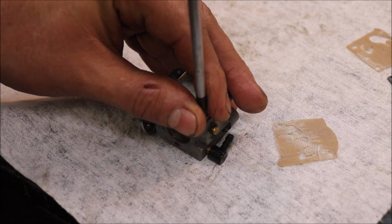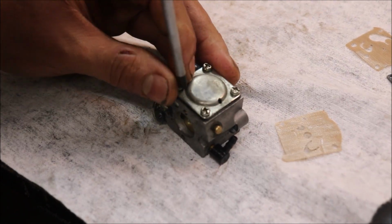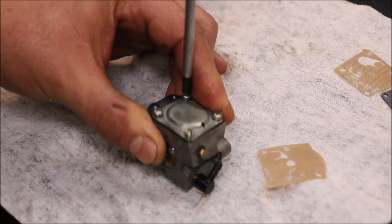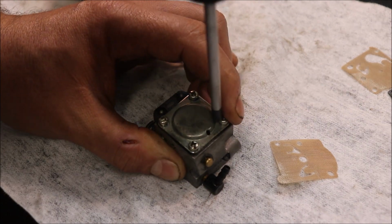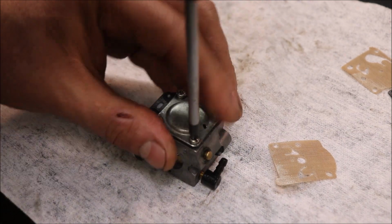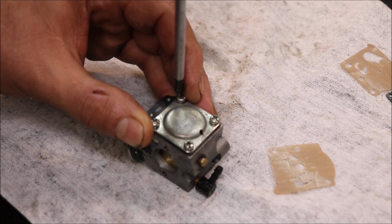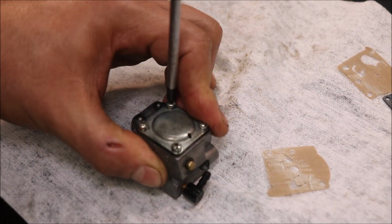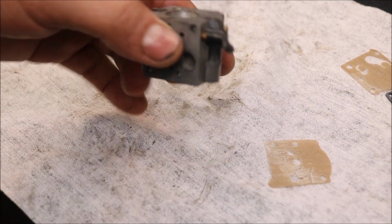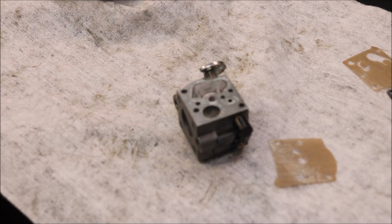I actually have another one of these saws. It's a 2000, I think. That is like in pristine condition. Simple Man had gave us. I had it out running it and then it just quit, so I'm assuming the same deal, diaphragms and the carb went, but we're gonna get that one out and put a kit in it as well and get it going, because I want to modify that one.